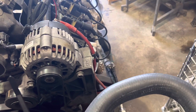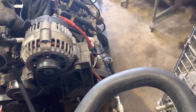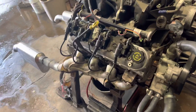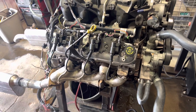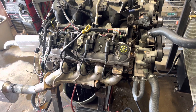This is an eBay fuel cell, and I've got the Corvette-style filter down there — so it returns through that. This is just a generic fuel pump; it's too small, but it runs this engine at idle no problem. The reason I say it's too small is it's only pushing 45 psi — I wish I got a 60 psi one.